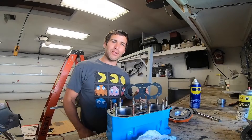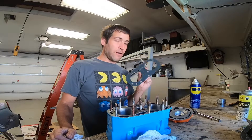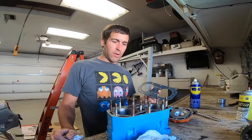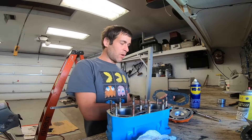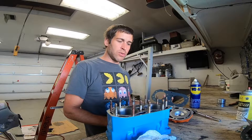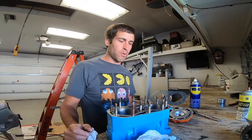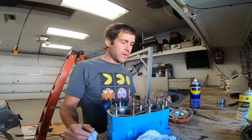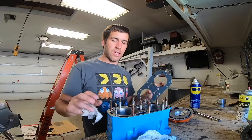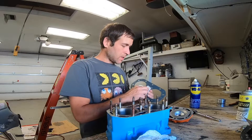I almost overlooked telling you guys — I'm going to be using this gasket. If it gives me problems or I have more leakage, then what I'm going to do is cut O-ring grooves in the head. I'll probably not actually use O-rings — what I'll probably do is use a piece of solid copper wire. Hopefully the head gasket takes care of any kind of inconsistencies and we don't have any leakage.